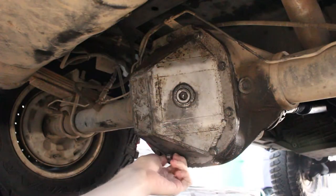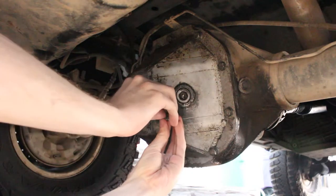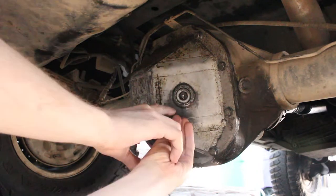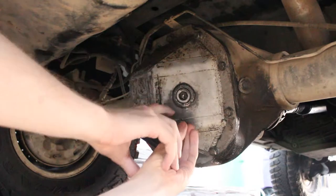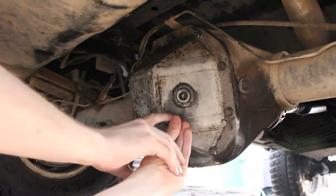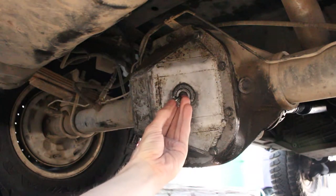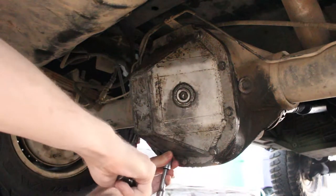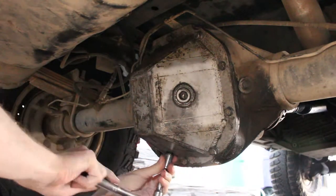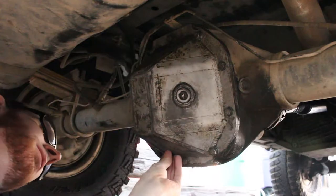I tried to find an o-ring for the drain plug, but after installing it I thought about problems with that idea. It's good that it has a lock nut on it because it won't back out — and this is a bolt we don't want backing out. But the problem is the gasket would seal on the outside, but then oil might be able to leak in between the threads and come out through one of those non-sealed surfaces. I then tried nylon washers with a flange bolt, but the nylon washers wouldn't stay concentric to the bolt once you tighten it up — the bottom one wants to flare out. So that kind of failed.